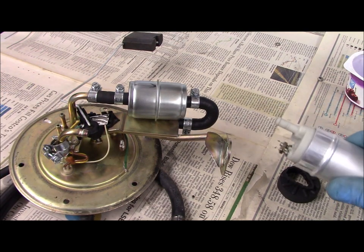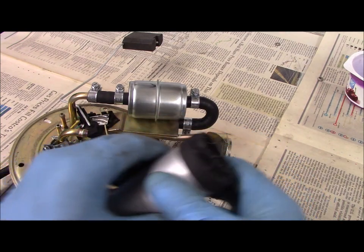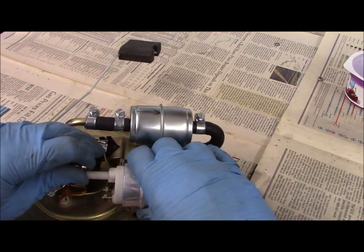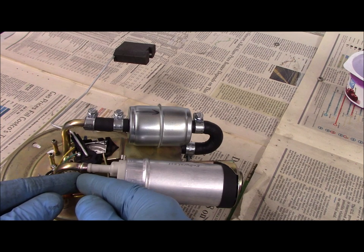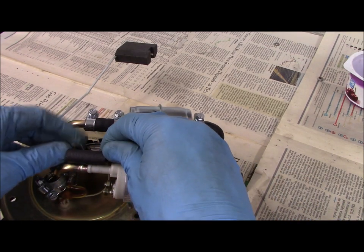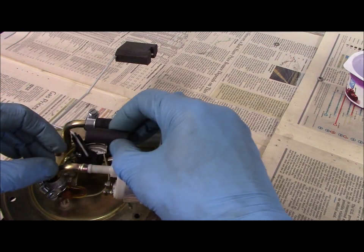That made me nervous because this is plastic and I don't want to put a lot of stress on it. I measured the old hose and it's 40 millimeters long, so I did a test cut — I took five millimeters off the hose and could slide it so it just got past the beginning of the pipe. That means I can put the new hose on and push it all the way down the pipe around the elbow to get the pump in. The reason it was so hard is that when you put the vibration damper on the pump bottom, the damper has a special shape that matches up with the bracket. The end of the pump and the end of the pipe actually touch with no gap. So my solution was to cut the new hose about five millimeters shorter — it will still extend past the raised ridges on the pipe and the filter, and the two clamps will go there.